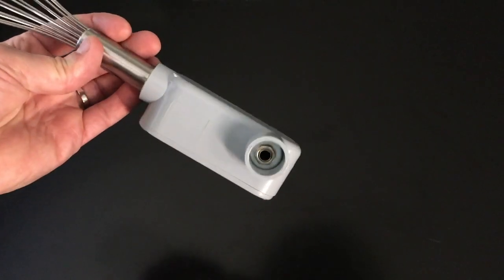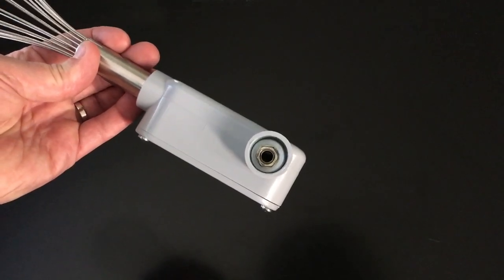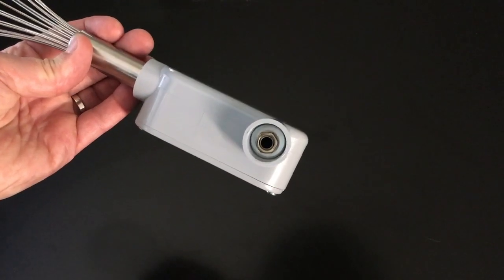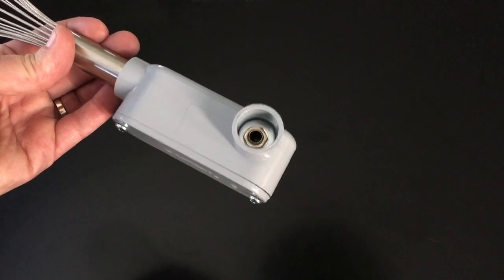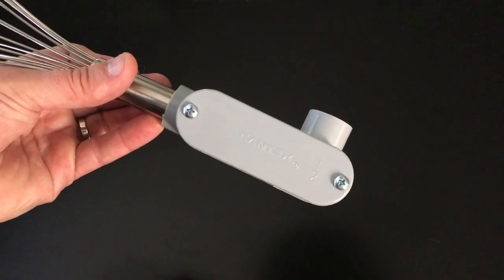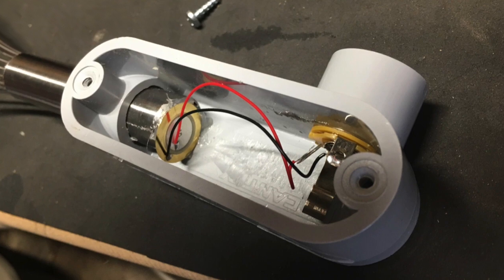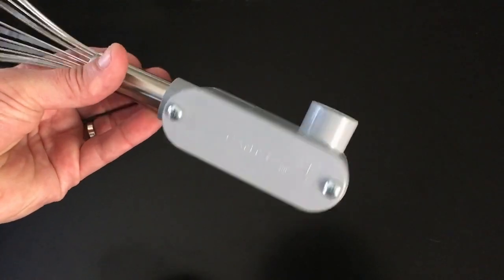And then it had this here, and a jack wouldn't quite fit, but I dropped that washer in there. I think it's a 1-inch with a 3/8-inch hole, if I remember correctly, but it's a common washer that I had laying around, and perfect. It gave me room to mount the whisk. So inside, there is a piezo hot glued to the bottom of the whisk, and then it's soldered to the 1/4-inch jack, and that is pretty much it.